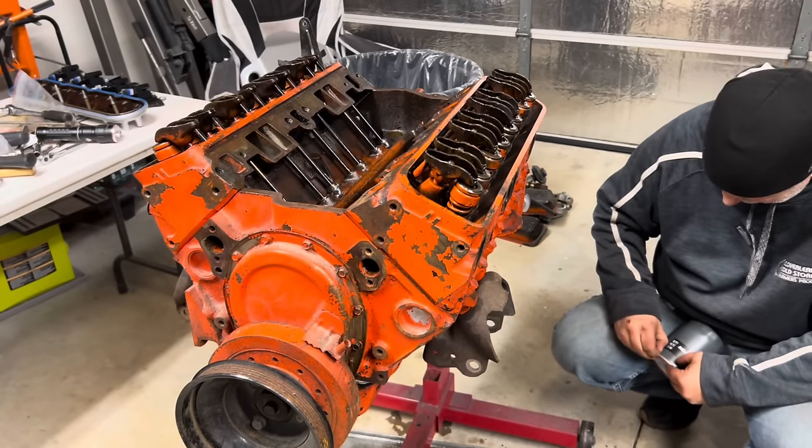Yeah, that's the flex plate's warped. It sure is. That shouldn't keep it from running for a few seconds. Well, no, it should run, but I mean, it's warped. I wouldn't be leaving that one off. You say that's a new one? Yes. One more time. But she runs. We heard it bark off. Yeah, that flex plate and starter combination is not happy.